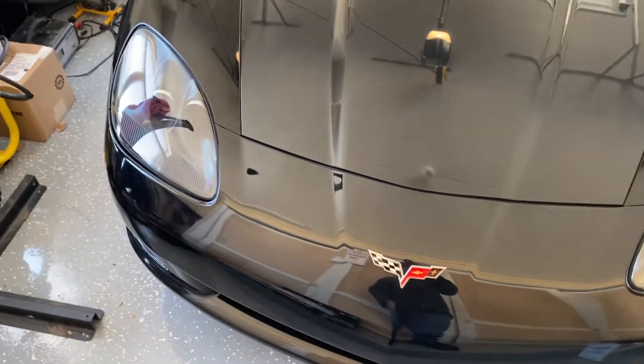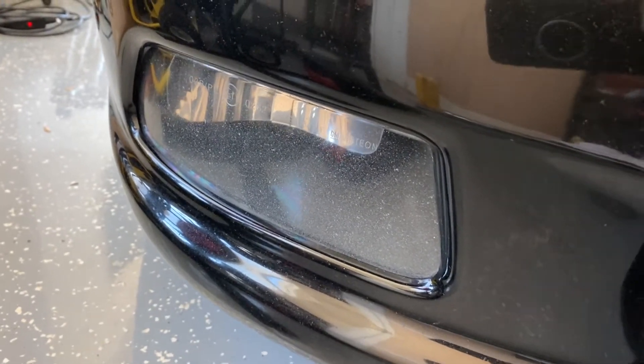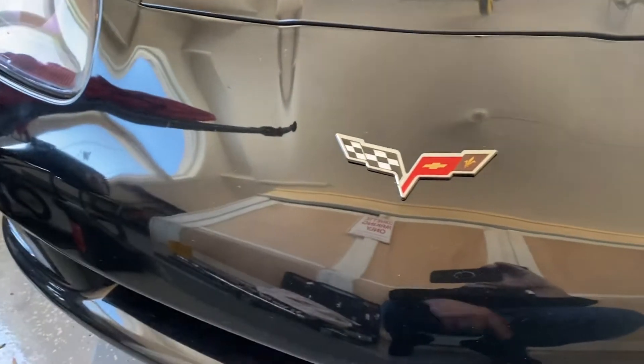As far as the front end goes, all the screws are back in and the wheel liners are back in on both sides. I did check the gaps today — both headlights are finally bolted in place, the front lip is bolted in place and snapped in, and the gaps look pretty even. The driver's side fog light is replaced. I'm going to sand the passenger side when it gets warm and polish it out so it matches, but at least it doesn't have the water intrusion the other one had. The headlight lenses came out great. All the wiring is done for the front camera and everything works.